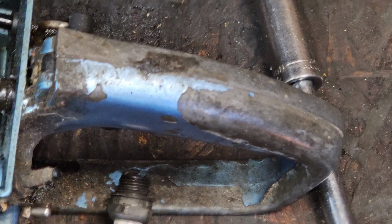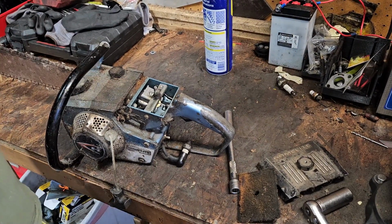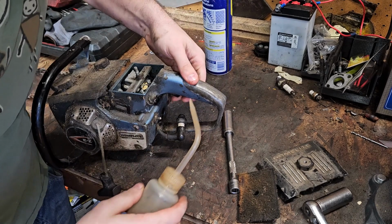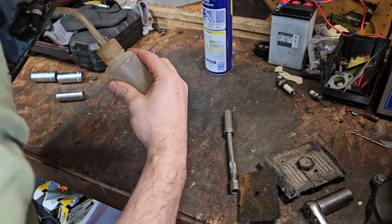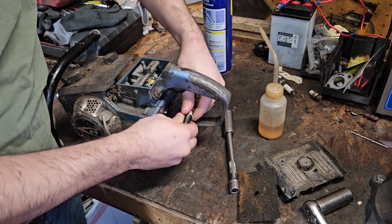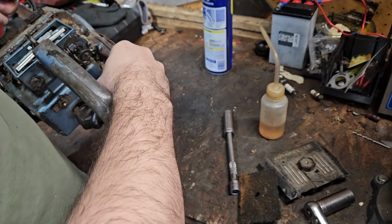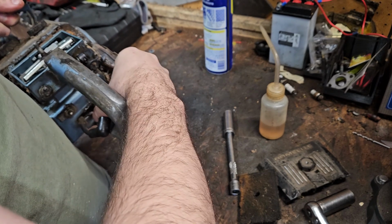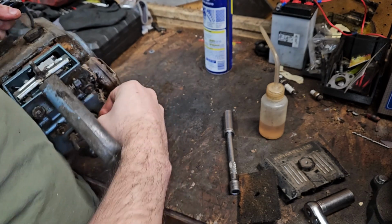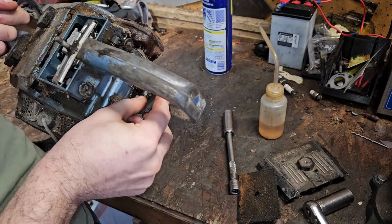You guys know what that means, right? What we're going to do next? You guessed it. We've already lubricated up the cylinder. Let's go ahead. Put a little bit down the cylinder here. A little gas. Take our spark plug out. Put this one in. Just finger tight. For just testing purposes, you don't have to crank it down.